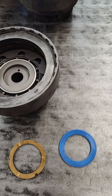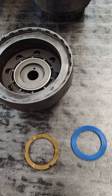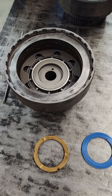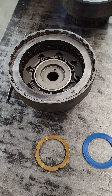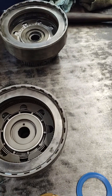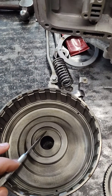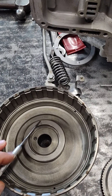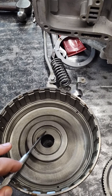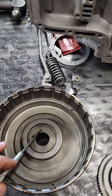Anyways, I'm not here to talk about that. What I'm talking about here is we've got a new product that's going to hopefully help you guys out and help me out here in the shop. So what's become a problem is this: the wide ratio gear kit requires the forward drum that has the bearing pocket. If you measure from here down to where the bearing sits, that's about 0.400 inches. So it demanded this drum.